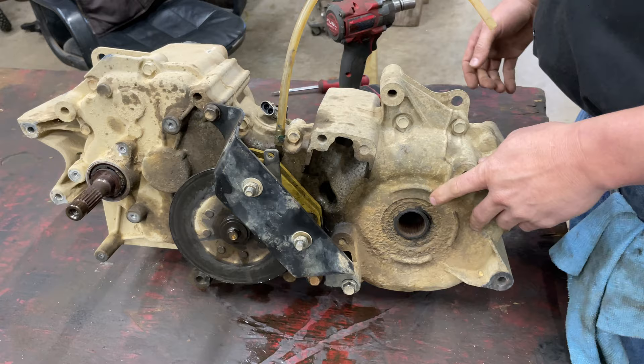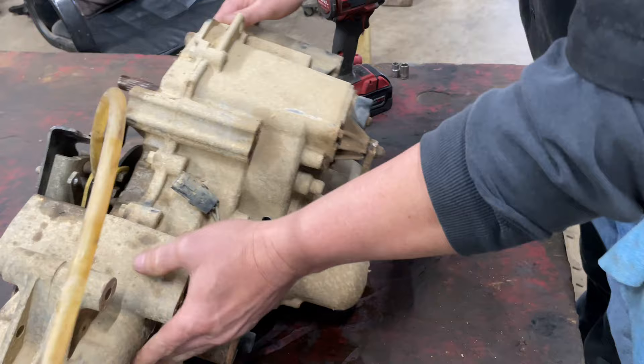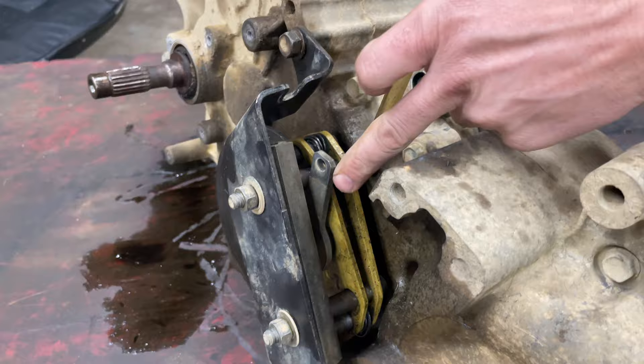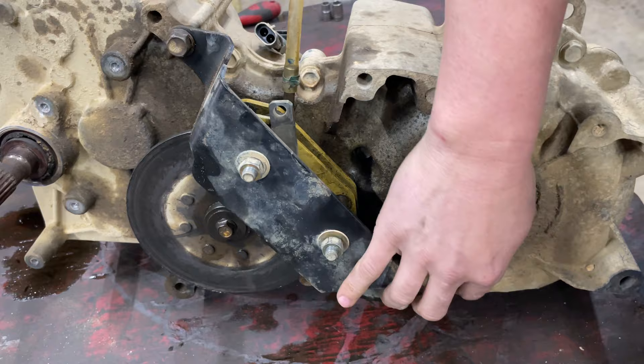The first thing we're going to do is take off this bracket and everything that holds the emergency brake on, then we're going to move over to the other side and take the shift position sensor and everything off — the levers and stuff that works the shifting. There are three bolts in this bracket and there are some ball bearings in here that this works off of. This is kind of worn so they may fall out — I've already had one fall out. Just keep up with them; you should be able to take these three bolts off and then this slides up.